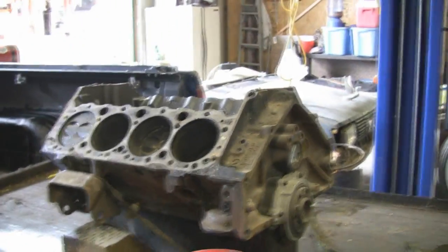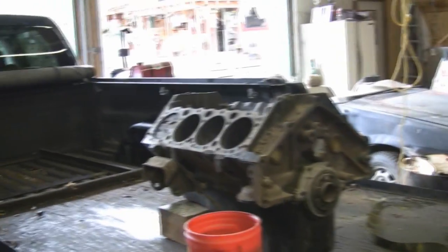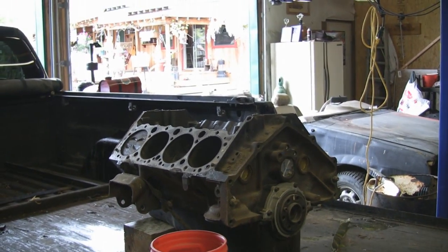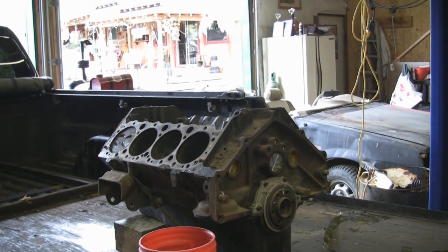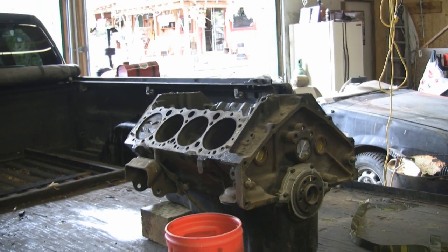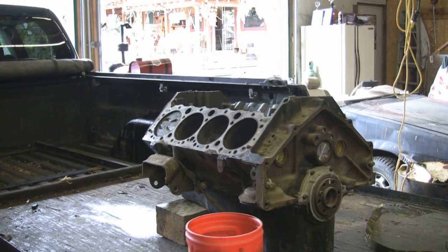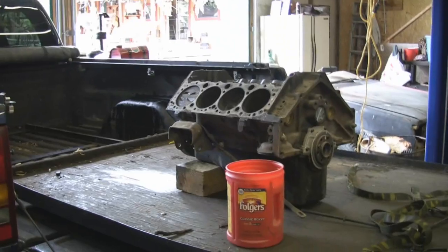At the same time, when I've got it apart, there'll be some modifications because the transmission keeps slipping in that thing, and the one that's in there won't hold up behind a V8. So I got a Turbo 350 set back there, but it's a bit longer, so we'll have to do some driveline modifications and that sort of thing, and rear transmission mounts and whatnot. But that's all fun stuff, and he wanted a project, and he's going to have one. So there you have it.